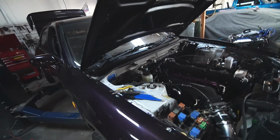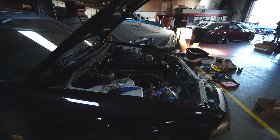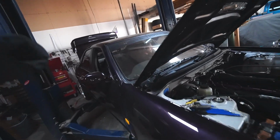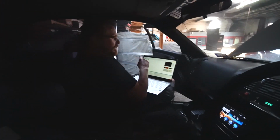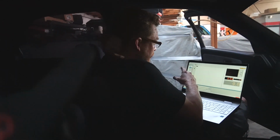It dies, so, yeah, I think it's probably super lean right now. Oof, stinky. I mean, I had to be like 100% open, so maybe the injector flow rate is off. I restarted again with a fresh map. Hold on, so back up. It was corrupted? The file was corrupted though.